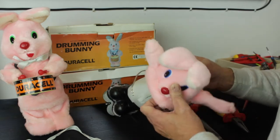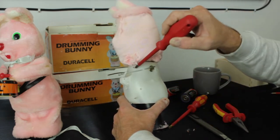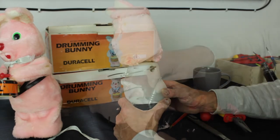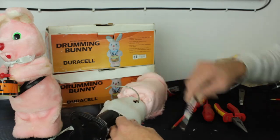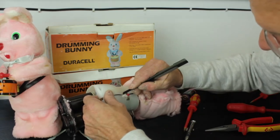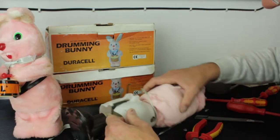Just fold your back — I'm not going to take your head off. I've got access to the mechanism now. There appear to be four recessed screws, of which one has fallen out, one is missing by the looks of it, and two are in place — so I can release that cover and have a look at the mechanism inside. Using an instrument screwdriver — these are very cheap to buy on Amazon and are quite vital if you're going to be taking things apart. Be careful not to damage the mechanism. Just going to pry it, stretch the glue — it's got a little tag on it stopping it. Let's release that tag.